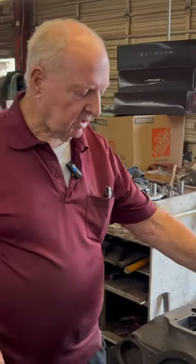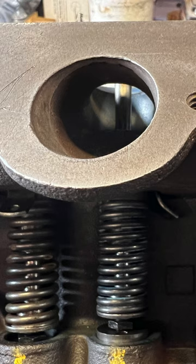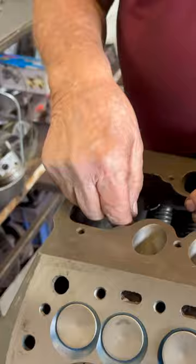I'm going to put the guide in the exhaust. I can't get in here, so I'm going to have this spring down here, and I want to put this valve and push the guide down. I'll put the spring in and the guide with the rubber O-ring on it. And then the valve is loose.